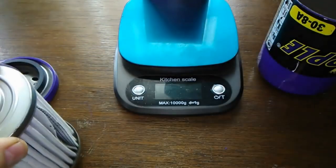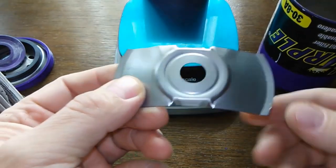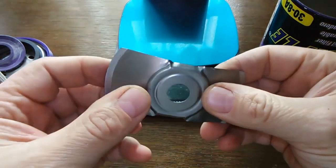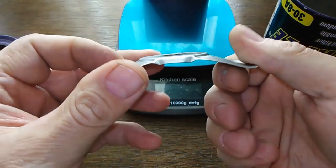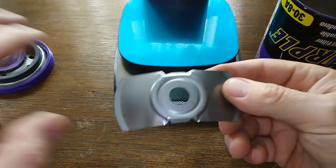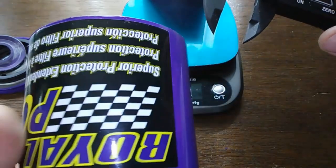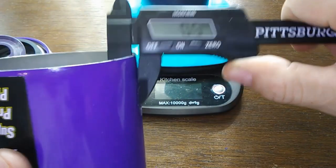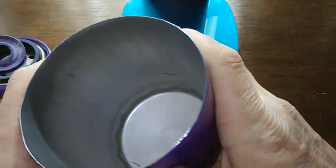Let's check out the can. You've got a stamped leaf spring, and there's a hole in the bottom — I can't understand why they put a hole there when the bypass valve is up top. I think it makes it weaker. The can thickness is 0.4 millimeters, which is a thick 0.4 — it's a well-made can. It didn't open too easily.